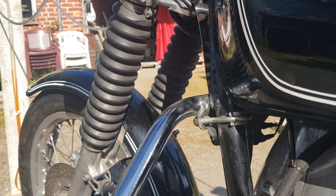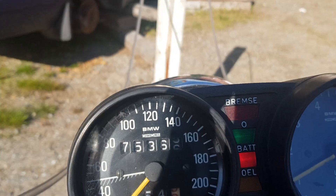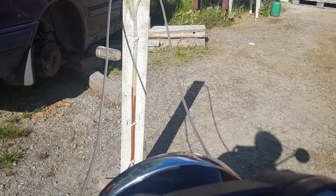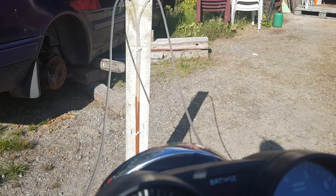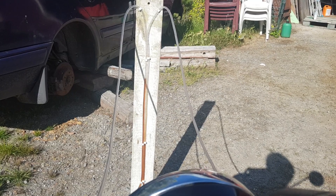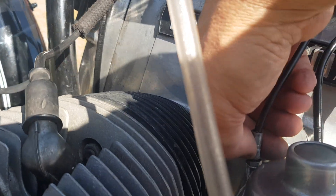Let me adjust this again to a more perfect position. What I am doing here is making the throttle pick up, and this is the point where I look for the most equal picking up. Because at higher RPM the vacuum difference will be small, but here at just the picking-up moment — it settles nicely. At just the picking-up moment I am getting a higher vacuum on the left cylinder.